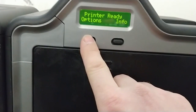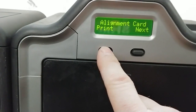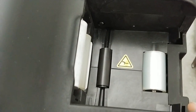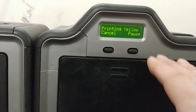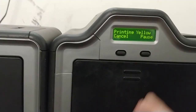We don't even need to plug it into the computer. We're going to click on Options in the menu, go to the menu that says Test, select it, and print a YMC color bar. Be ready to watch — click that, see it moved in there and now it's fed. So we can see it's not this roller or these rollers that caused an issue because it fed. It's going to take a minute to warm up, so what we're watching for now is: does it print and exit?